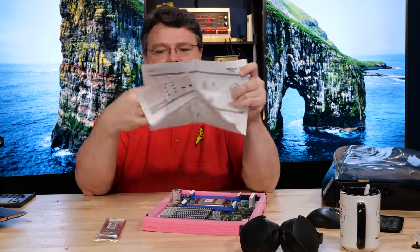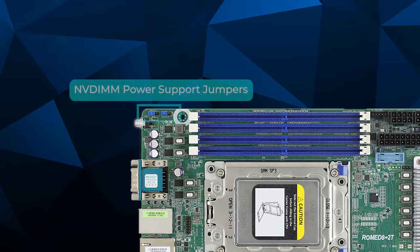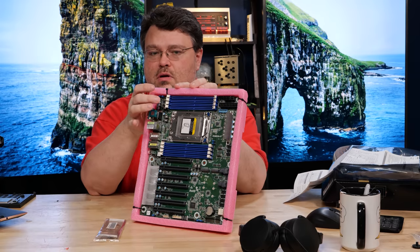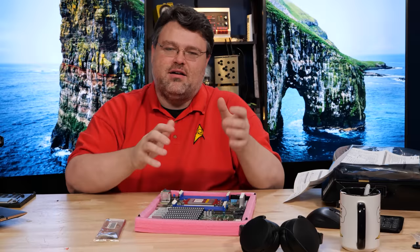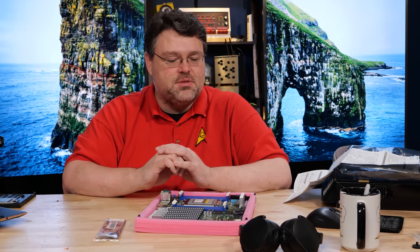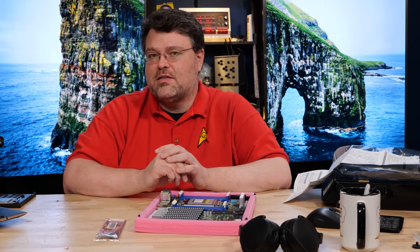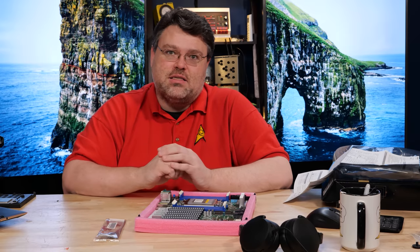You also only get a quick installation guide in the box. There are two jumpers located at the very upper edge of the motherboard near the rear IO — these enable extra power for the DIMM area so that you can run non-volatile DIMMs. Non-volatile DIMMs are still perhaps a little experimental on the EPYC platform. Chances are if you're doing that, you're spending millions of dollars on an R&D project.